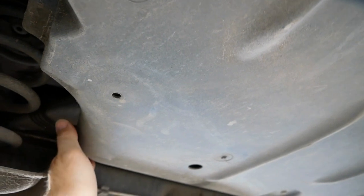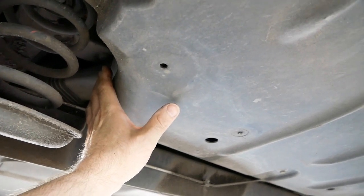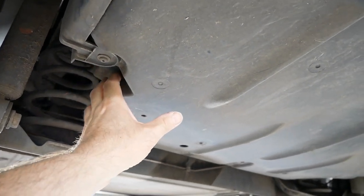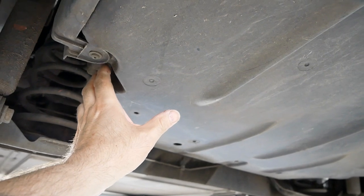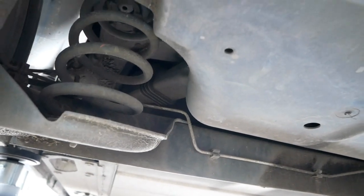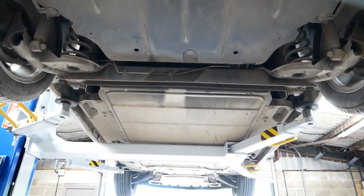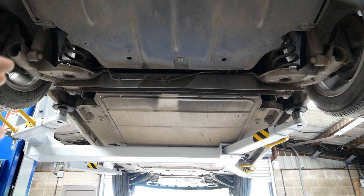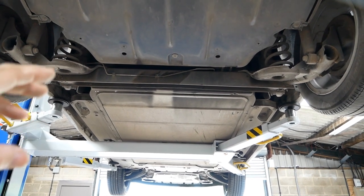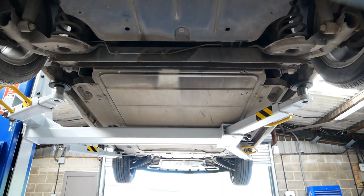At the back we've got the rear suspension and plastic underneath the back bumper. There's a venting hose back there. In the boot of these, underneath the boot floor, is a cooling fan — you can just see the ducting going across. Not much to see really, but it's all completely flat and flush, which improves aerodynamics — hence why racing cars have very flat floors. Much better than all the cavities you get with an ICE car with an exhaust running down, the fuel tank and everything else.